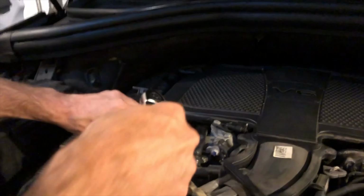All right, guys, so we're all done. So we spun around the block a few times, got that temperature up to about 90 degrees. It pinpointed at 90, didn't drop any lower or higher. That's what we want. It stopped fluctuating. That was perfect. But the low coolant light will come on because the temperature will rise and it's gonna drop the level because it's all gonna fill up and get all the air out of there. So you're gonna have to top it off.